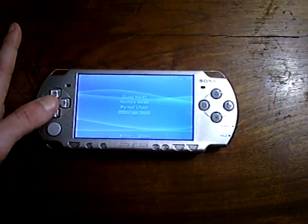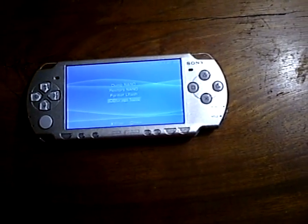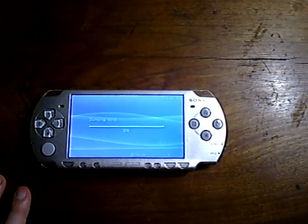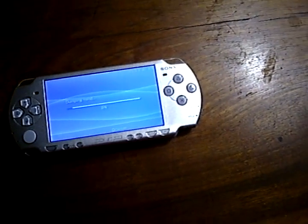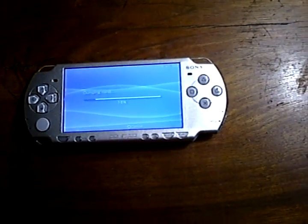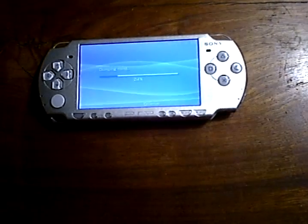Then there's ID storage tools, which is a submenu containing various tools to fix problems that could happen with the PSP. We are wanting to choose dump NAND, and a progress bar shows up where it is dumping the NAND. The NAND dump is made to the memory stick and takes up about 66 megabytes.